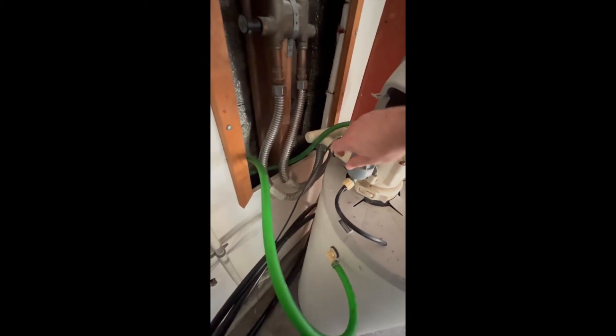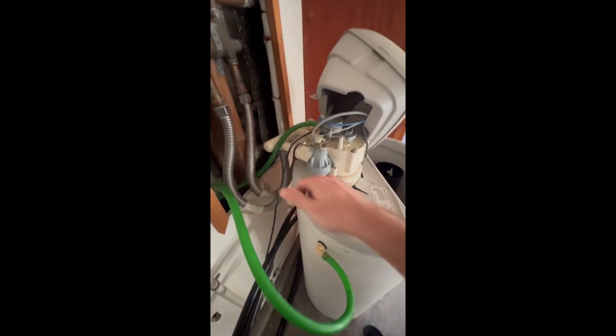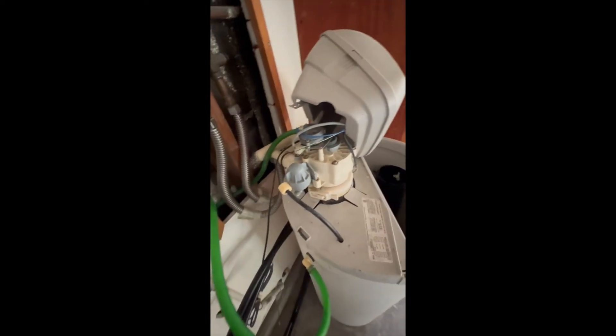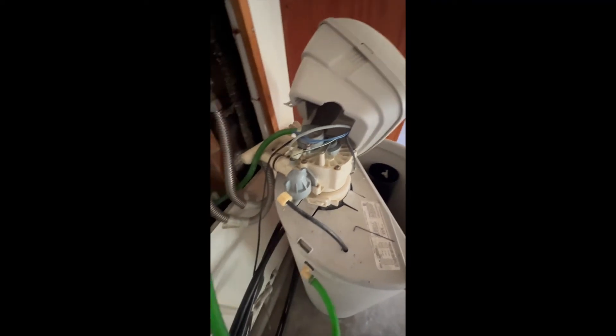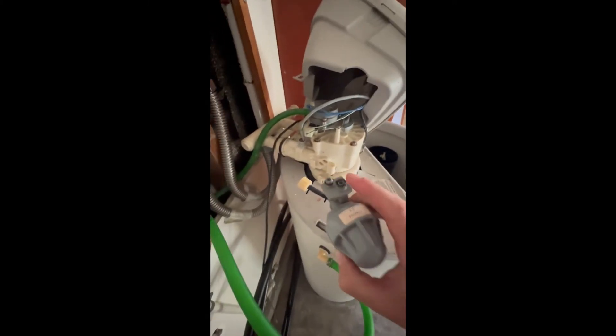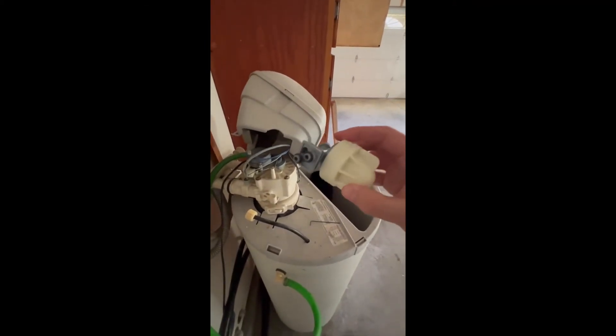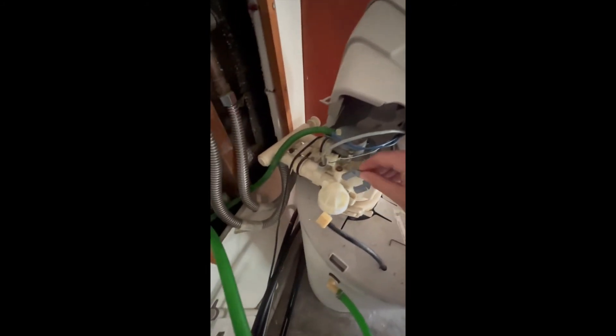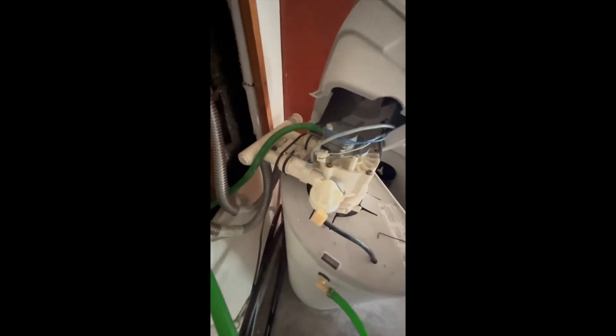So basically what we're going to do is take off the hose. You're going to lift up this clip right here in the back — that's where you need your needle nose pliers or channel locks. Just lift it up right here, then take this piece off, and pull out this guy — comes out just like that. Then you have your little O-rings attached to it. To replace it, I got my new one right here. I put my O-rings already on top of it, and I'm just going to plop that guy right inside there. Then it comes with a brand new clip, and I'm going to clip this guy right onto there like that.